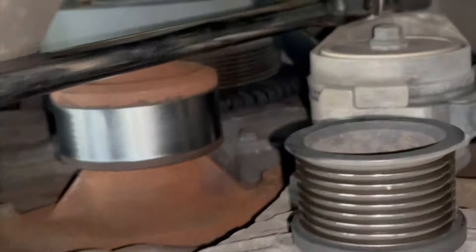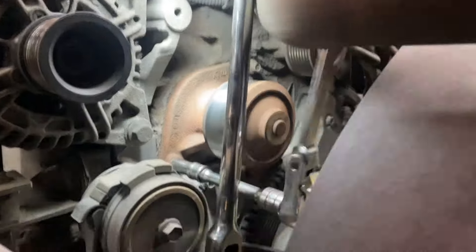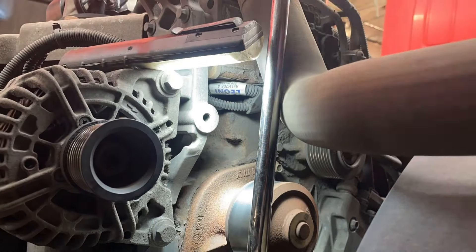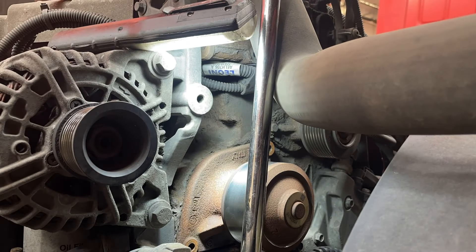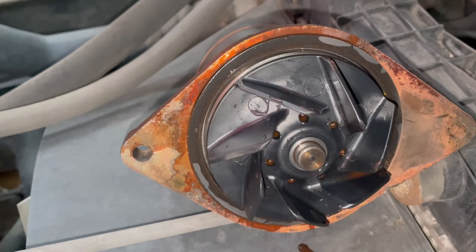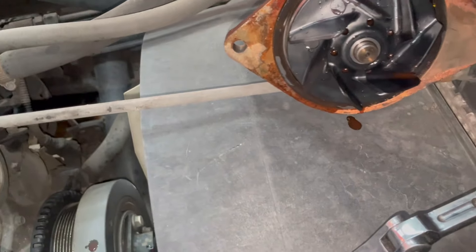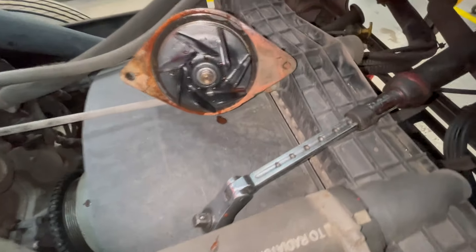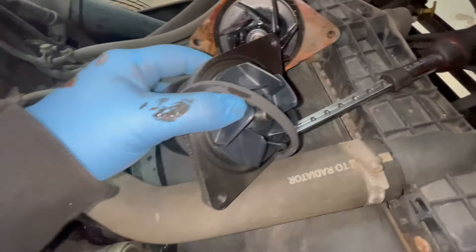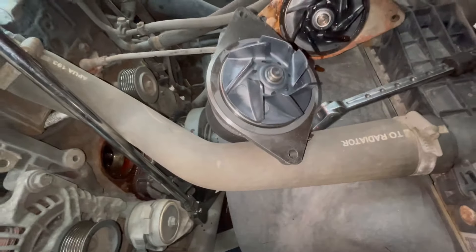First thing we need to do is take the belt off because it is our water pump - it's got a half inch drive there. So let's get the belt off. There's our water pump - literally just 10mm bolts, one, two, I think three on there - quick and easy. So we've got it out and we'll have a look at it. Here's our old water pump - been weeping out a bit. Here is our new one. We're going to put a bit of grease around the seal obviously, and two new bolts - easy as that.